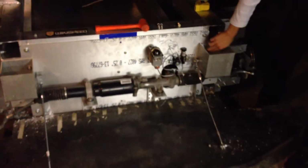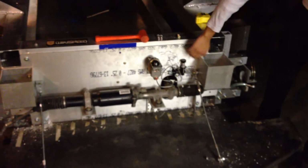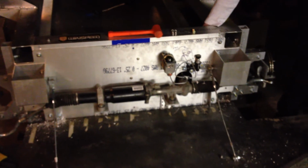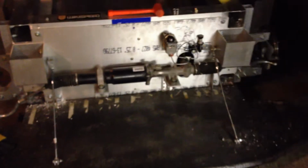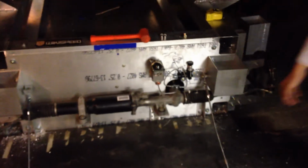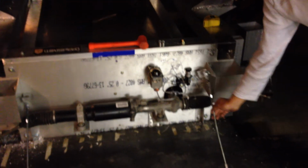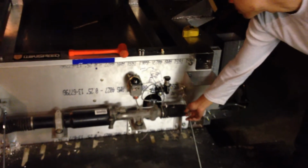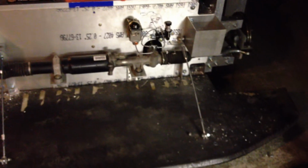I just drilled 2 holes here into this pedal plate, and then it just goes into the back. And that's the start of the front crush structure. Yes. Those are the standoffs. And then for that, you needed to lower the splitter mounts, right? I had to remove these, and I had to cut these 2. Shorten the splitters. Yeah, shorten the splitters. Okay. And so those haven't had new holes drilled into the pedal plate yet, but the threaded rod has been cut to the right length. So it's ready to drill.